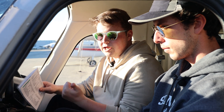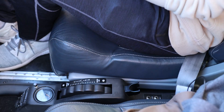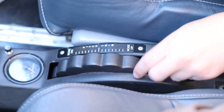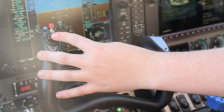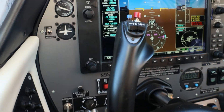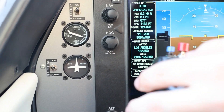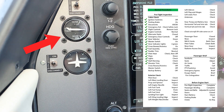Just like we had our rudder trim, we have two trims in the plane: a manual wheel and electric trim. The manual wheel sits down here between us — from me in the right seat, this is my main source of trim. The wheel's connected straight to the stabilator in the back of the plane. Also on your yoke, we have an electric trim — you can go up and down, and you can actually hear it working. The indication is right above our rudder trim, telling us nose up and nose down. We're going to go ahead and set it so that it is nose level.